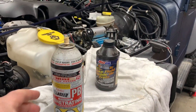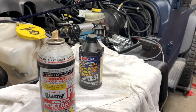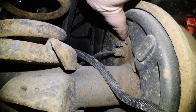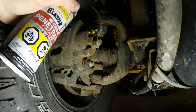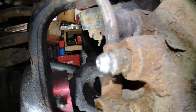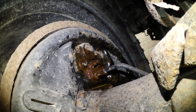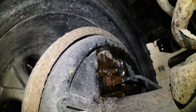In this video I'm going to give you some tips and tricks on how not to bust off your bleeder screws. The first thing I'm going to do is spray down all the bleeder screws with PB Blaster and let it sit for pretty close to about an hour. You can see one of the bleeder screws right there, identified hopefully by a rubber cap to help keep the dirt out. I'm going to take that cap off and then spray it. You can see right there that looks pretty corroded. Just enough — let that settle in there. Once you've got them all sprayed, I like to let them sit for at least a good hour, let it soak in a little bit, and hopefully we won't have any issues when the time comes.